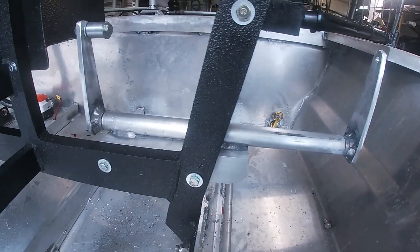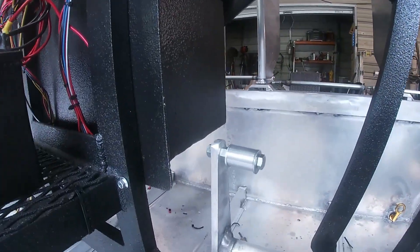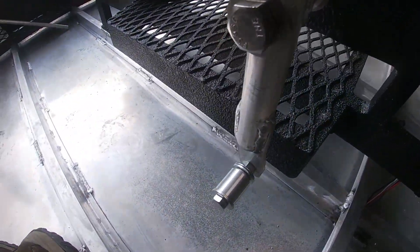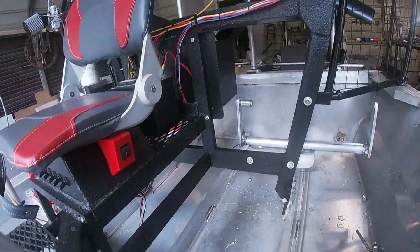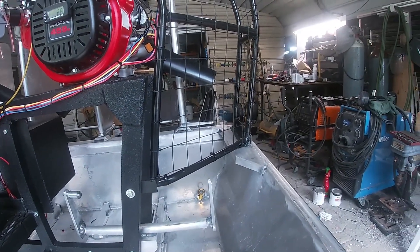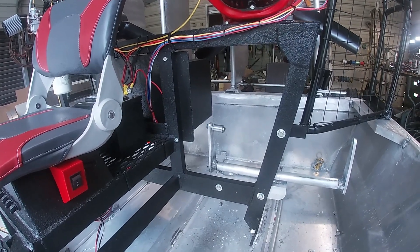All I did is got a little arm that comes up right there — it's going to transfer the force to the side over here and it's going to line up with the rudder on the back. I made some little bushings, and I'm going to weld some one-by-one tubing on that end and on that end. Hopefully all this stuff is going to line up and I'll be back in business. Let me get this thing on the water and see what it's going to do. I'm going to put some rod in the bearings on this side — made some bushings and hopefully got it lined up where it's going to work. We're going to find out shortly, we'll be back.